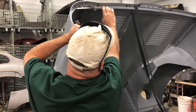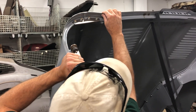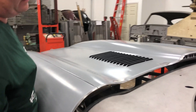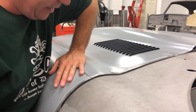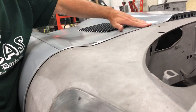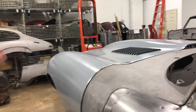You can see up here there are some spots I haven't sanded down — this is where we've made sure that the rear edge was tucked in nice and tight so that the seal keeps from popping out. When you go ahead and close this, you've got a nice follow there. This will all get smoothed out and block sanded at the next shop, which is the body shop.